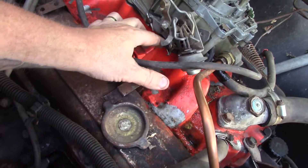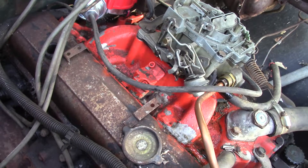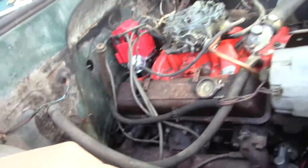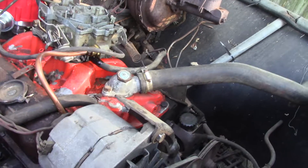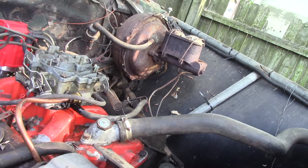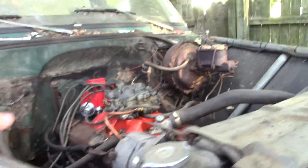It's coming out the sides too. I'll get the studs and gaskets for the Edelbrock and give it a shot. Besides the brakes - I ran all new brake lines on this thing except for the two going from the master cylinder to the junction block. All new lines, calipers, wheel cylinders and everything. I'll pick up another master cylinder and get it on there.